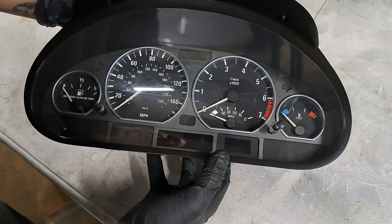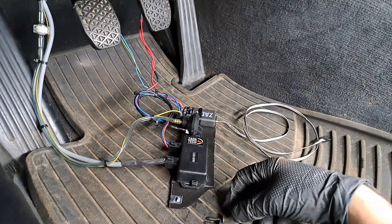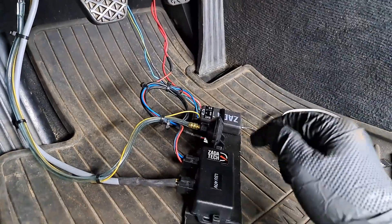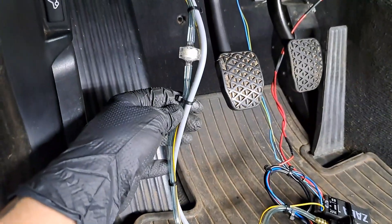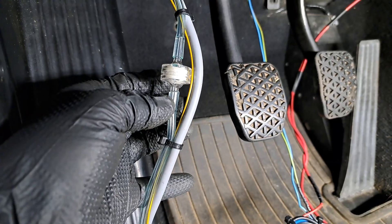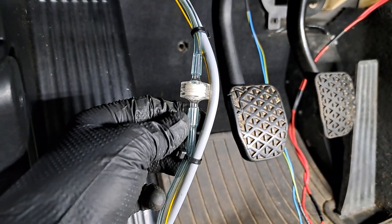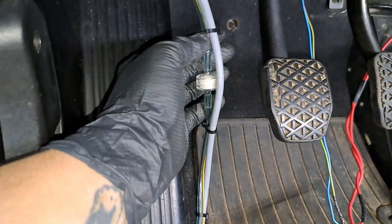Check that out — you would never guess that right here lies a boost and AFR gauge. Here we are in the cabin of the car. The wiring will vary depending which gauge you buy. This particular product is both the AFR and boost gauge. This bundle right here is the AFR and boost references — the gray harness is the AFR cable that goes to the sensor, this yellow wire is for data logging and goes directly to the ECU or DME, and this hose right here is the vacuum and boost hose with the filter.